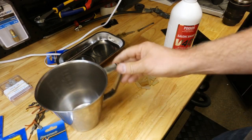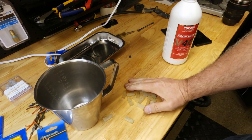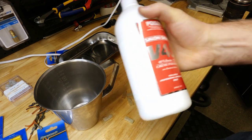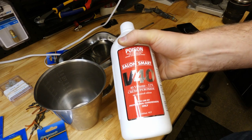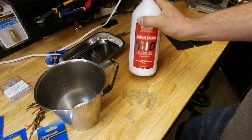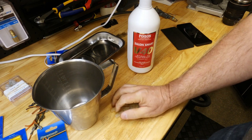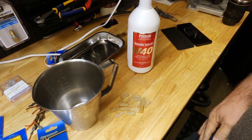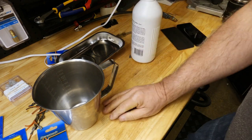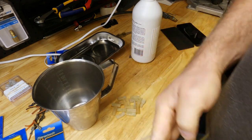You can look it up on YouTube. People doing this with old computer parts, and what they're always on about is what mixture of this stuff. Basically, it's bleach, and it's in a cream so that it stays on the parts. I think if you could immerse the parts, you could probably not use the cream. They also go on about UV light. I'm not convinced the UV light serves any purpose. As far as I would guess, it's just the bleach that matters.